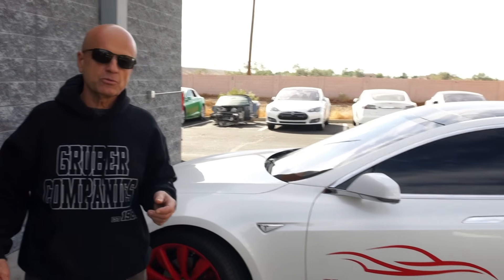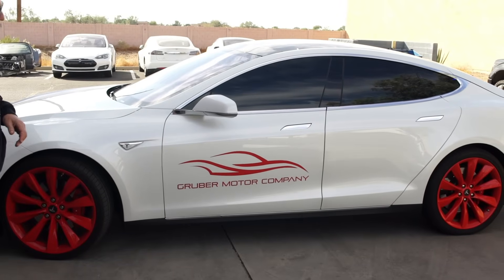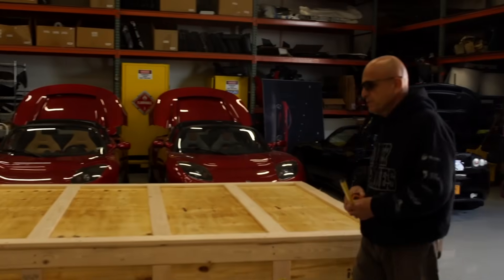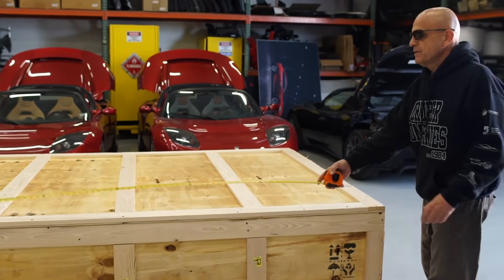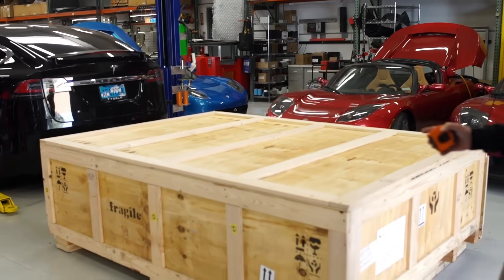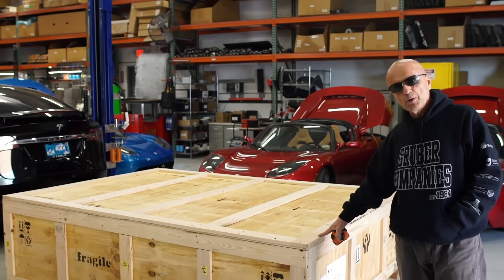You might wonder how you replace a large battery like this. The weight of that battery is from 1,000 to 1,200 pounds, and it's very large so it doesn't simply fit on a 4x4 pallet. Shipping something that large to a service center requires a custom crate. The length is just under eight feet, the width is five and a half feet, and the combined weight of the crate and battery is 1,358 pounds. Inside is a Model 3 propulsion battery pack.